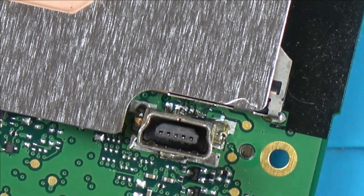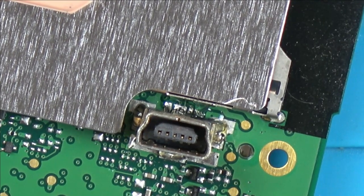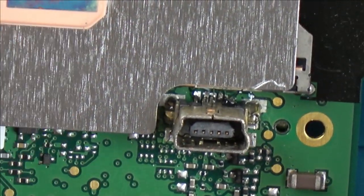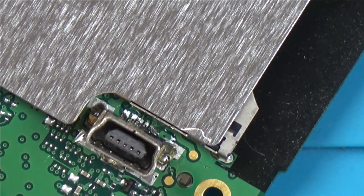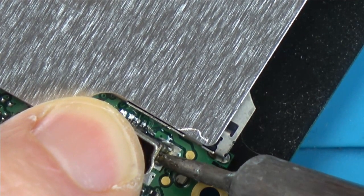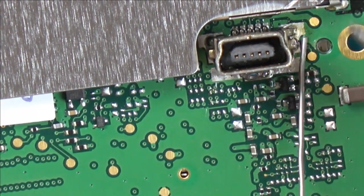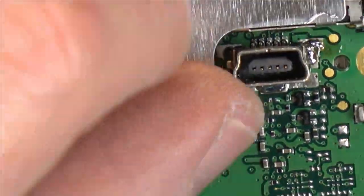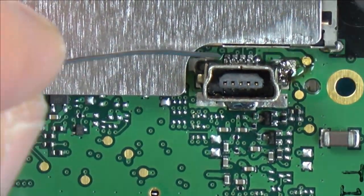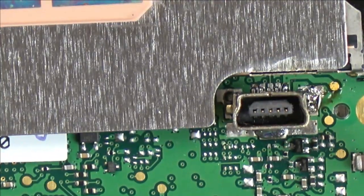While I'm waiting for the soldering iron to heat up, I'm getting my isopropyl alcohol ready to clean it all up at the end. If those pins were the other way around I would be very confident about doing this, but because the soldering iron is going to be hard to get in there, I think I'm just going to have to try to reflow what's already there rather than add new solder. I'm at 480 degrees Celsius with a medium-sized tip. You'd think this would be quite easy, but it was a right little pain because the tip isn't quite big enough to melt the solder properly - the board's draining away the heat. But if I use a bigger tip, there's just lack of space.